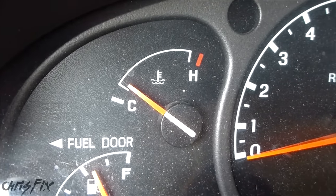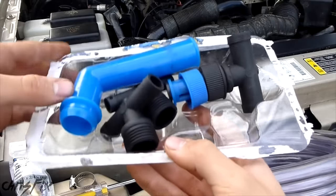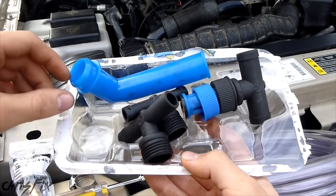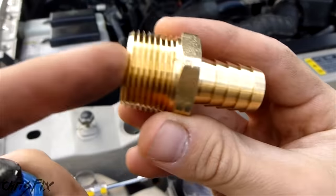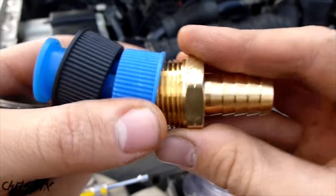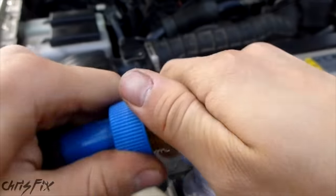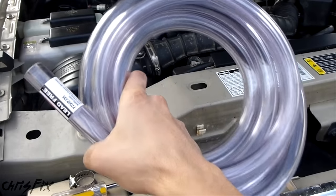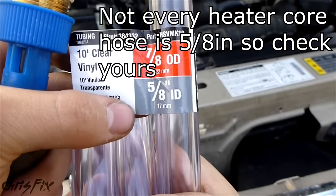Now you want to make sure you're doing this when the engine is cool. You never want to touch the cooling system with the engine hot — make sure that needle is on cold. They make these little flush kits, they're five bucks at your local hardware store. I'll put a link in the description. I'm going to use an adapter from my local hardware store that connects to my hose. I'm using the adapter that comes in that flush kit and connecting it to a 5/8-inch inner diameter clear hose — the inner diameter is the important part, not the outer diameter.